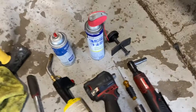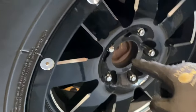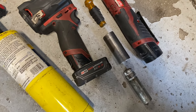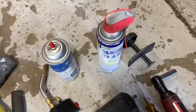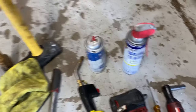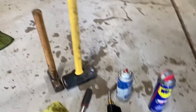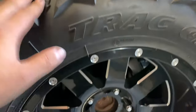For the necessary tools: we've got the 10 millimeter socket for the guide pins, a 21 millimeter for the lug nuts — in my case I have spline lugs so I need an adapter — and also the 21 millimeter for the bolts that hold the caliper bracket. You'll need a half inch and a three-eighths driver, a caliper compressor tool, and a flathead screwdriver. Because we're in a rust state we'll have some persuasion tools: WD-40, heat, a big hammer, and a little hammer.